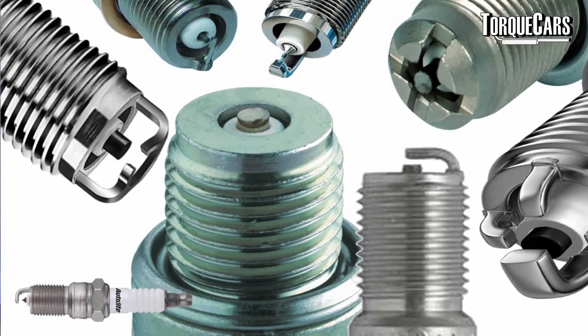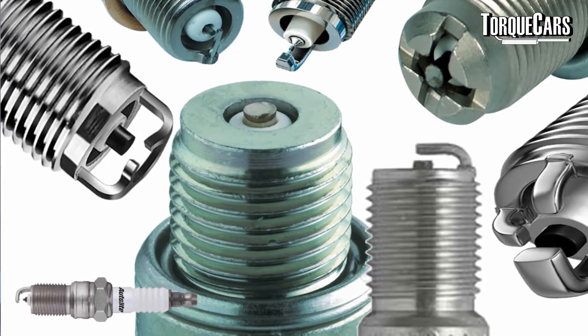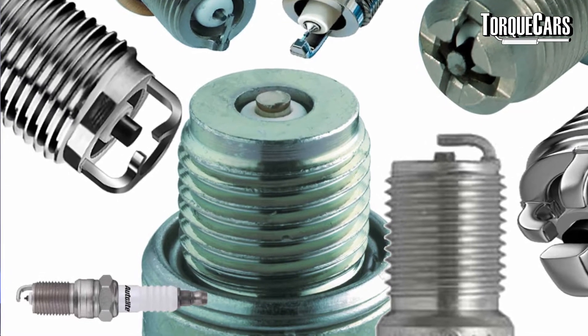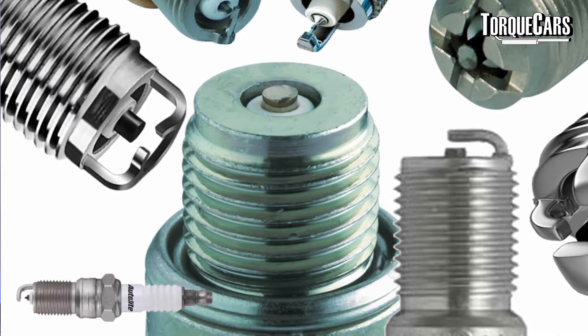The low-angled spark plug design has a lower profile than a standard ground electrode. The angled version provides a quicker path, dissipates heat better, has more vibration resistance, needs a much lower voltage for sparking, and can improve power and fuel economy. Next is the multi-ground electrode, which has two main ground electrodes used primarily in rotary engines or in applications with very lean air-to-fuel ratios.